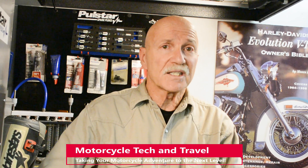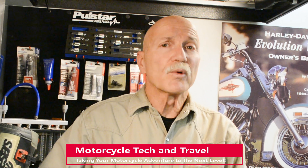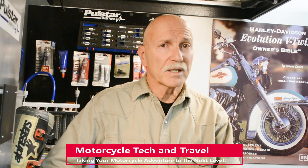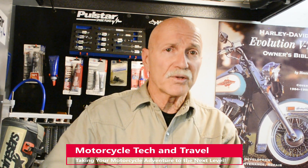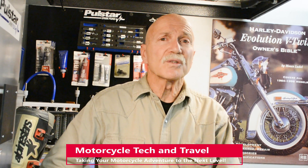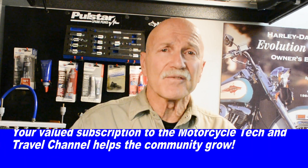I would re-jet a stock 1986 or 1987 Sportster for 4,000 feet; a trip down to sea level would then require reinstalling the original, richer main jet. If re-jetting gets overlooked, a rich running condition can harm the engine — running too rich can fuel-wash the cylinders of vital oil, flood the engine during startup, dilute the oil, build up carbon, carbon-foul the spark plugs, or cause poor running. Conversely, when jetted leaner for high altitude, dropping altitude and running too lean can cause engine misfire, burned spark plugs, ping or detonation, and excessive heat — with potential piston damage or seizure.